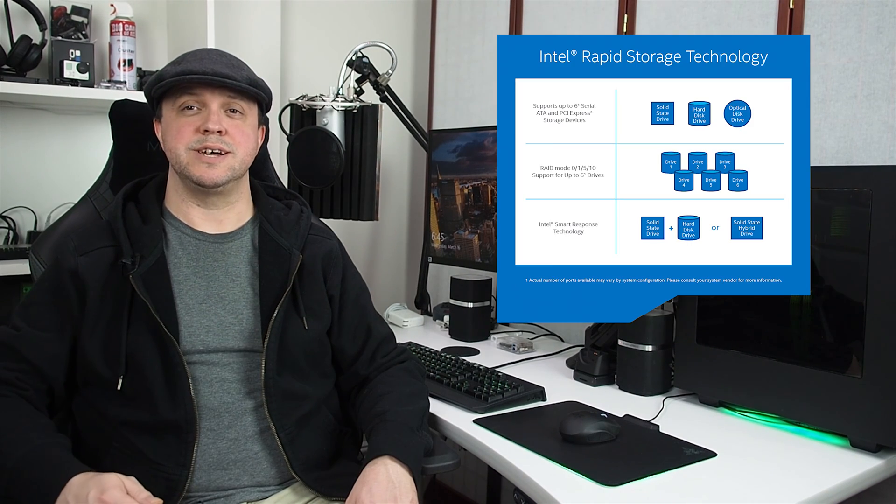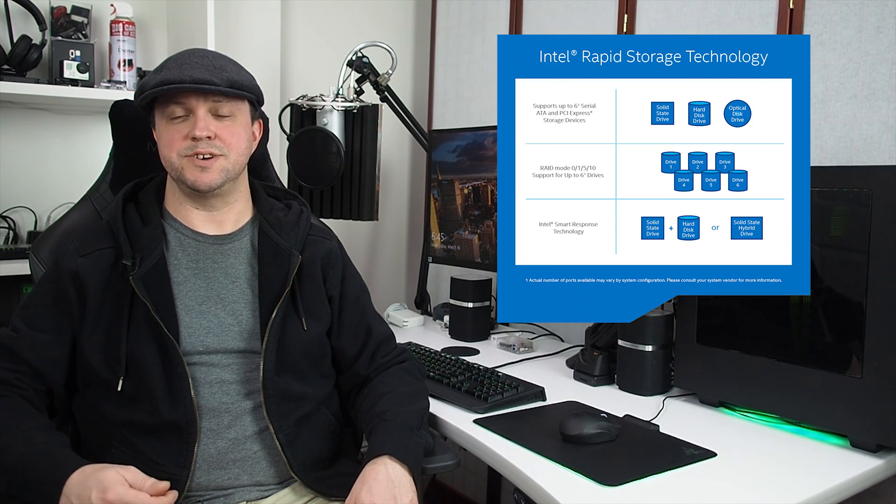Hi guys. Back in this series of videos, I built Linnean Hydra, my video editing workstation, whose data storage is three SSDs in a RAID 0 stripe that give me 1.6 gigabyte per second read speeds and 1.2 gigabyte per second write speeds. The RAID itself is handled by the motherboard via Intel's RST, or Rapid Storage Technology, and the aim of this video is to show you the different RAID options that are available and the kind of performance you can expect using various combinations of drives and also the various stripe sizes.